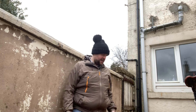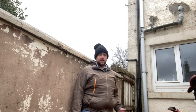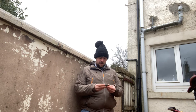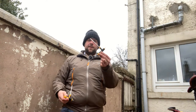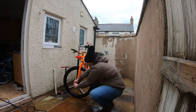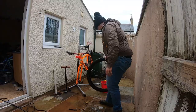Now, an important part of this bike cleaning routine is that whilst we clean everything, we check it. So it's a bit more of an advanced M-check. So for that reason, I'm going to start at my front wheel. On the roadside repairs video we looked at multi-tools like this one, and you can use this multi-tool to do virtually everything I'm going to show you today, but it's a lot easier to do it with proper Allen keys. Today I'm going to use this type. Putting the ball end in, allowing me to spin it. Taking that bolt through axle out and lifting the wheel out.